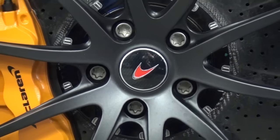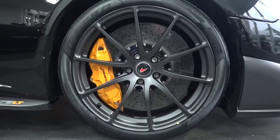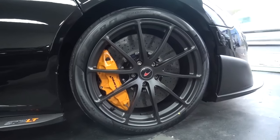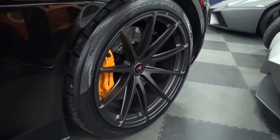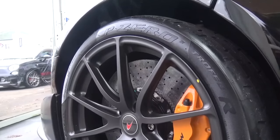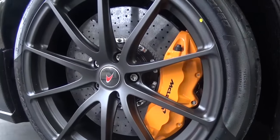Stiffness is increased by 23% at the front and 63% at the rear, with lighter springs. This model has been specced with the 10-spoke black alloy wheels, 19-inch at the front and 20 at the rear, where they are also slightly dished. Pirelli P Zero Trofeo R track-ready tyres are fitted here, and at the time of publishing, this is the lightest wheel setup offered by McLaren.